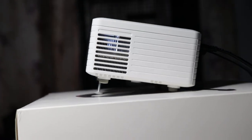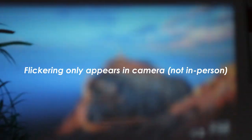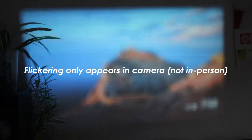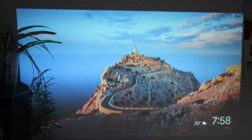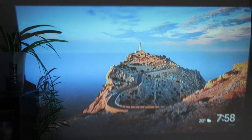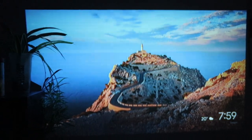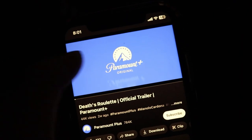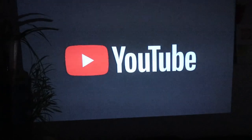Here is the Yotan Y3 projector set up on top of a few boxes — you can set it up however you want. I also elevated it using the screw mentioned earlier. Here is the video quality projected on the wall. It looks a bit blurry, but you can use the focus ring on the side to adjust the quality. You can also use the keystone to adjust the angle. When I turn off the studio lights, it makes the room darker and improves the contrast. Now I'll Chromecast a video to show it in action.